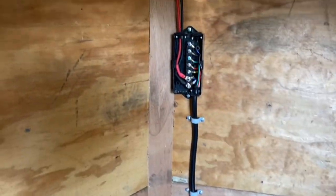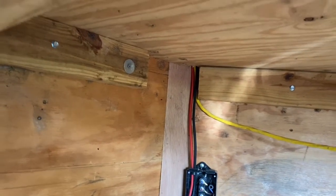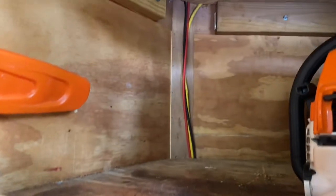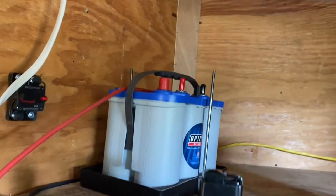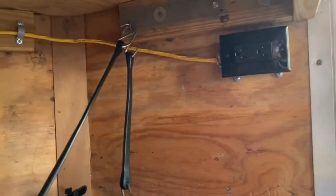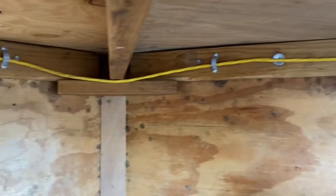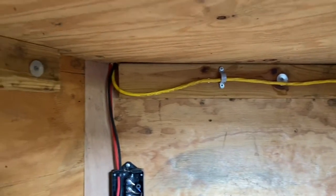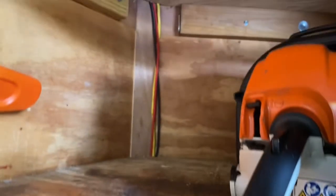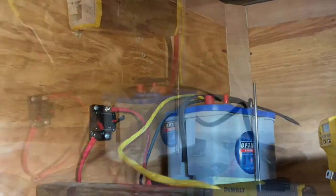Here's that 7-pin box — I run 8-gauge wires from the positive coming off the 7-pin and the negative, and I bring them up. I put the red on positive and the black on negative, because that's the way the battery is hooked up and you won't get confused. This wire running through that outlet is for the small air compressor, so if he has to blow up a tire on his trailer or his lawn mower he's able to do so. Make sure your battery is tied down and start bringing all your wiring to the location of where you're going to set everything.